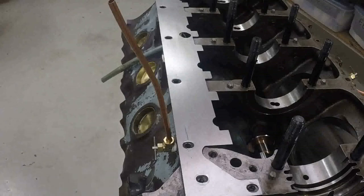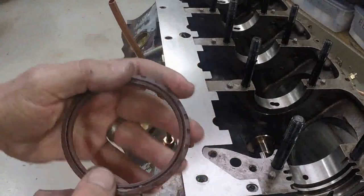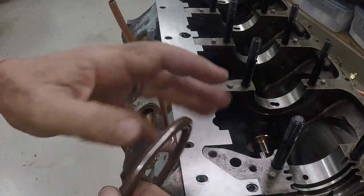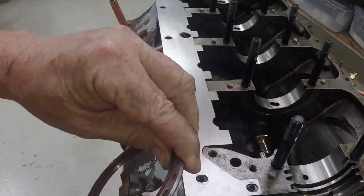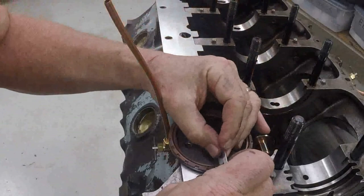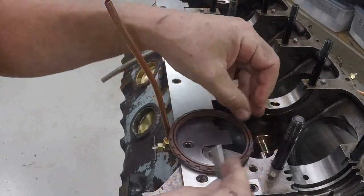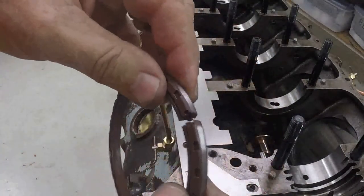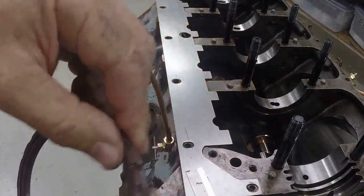Okay, I've got the seal out. And remember that the spot where it has the little hole is where you cut it. You can actually see where I had to sand quite a bit of material off of there to actually expose that middle ring that's inside it. Well, that's where the cut line is — it's where the open spot on the ring is. So we'll take the razor blade and very carefully cut right straight down. Done. So now when we install it, these two halves of the seal should be made up perfectly and restore the seal. That's the whole idea.